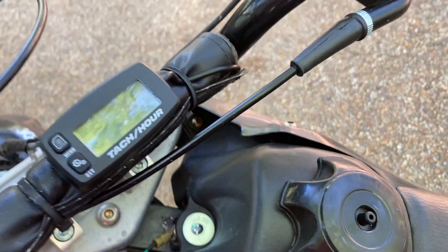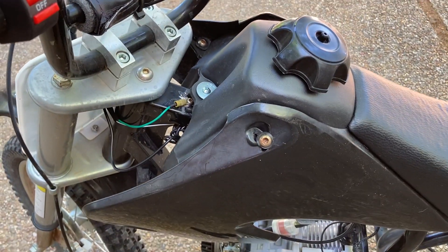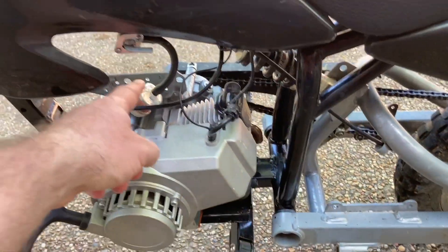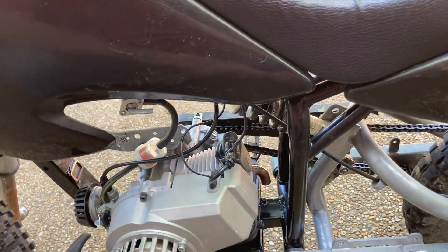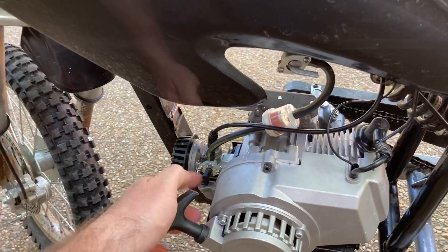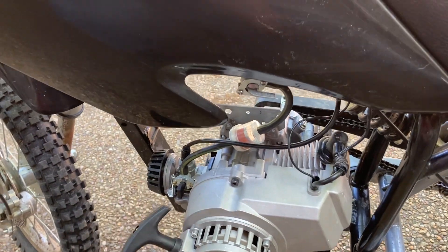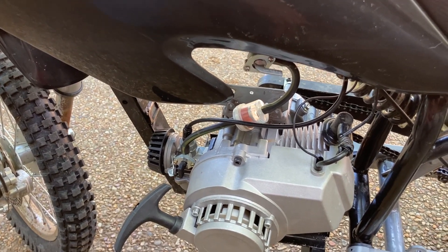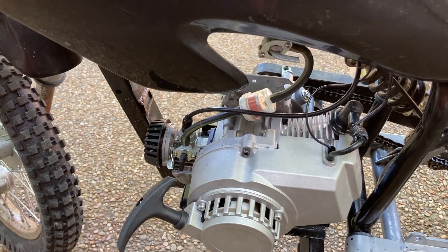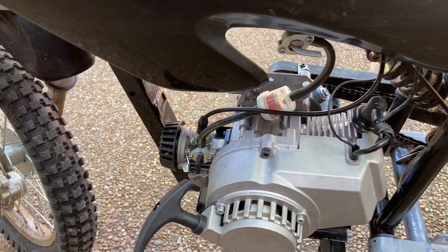You can see the holes that came in the gas tank mount here, but we drilled these holes here and here for the fender to mount to the gas tank. The gas tank came with fuel line, a fuel filter, and a fuel shutoff valve. I would not recommend messing with that valve — it's not very reliable. Just don't mess with it and it won't leak. If it does leak, take it apart and get it all set back up, and just don't turn it.